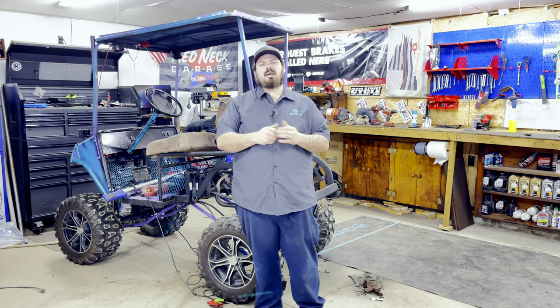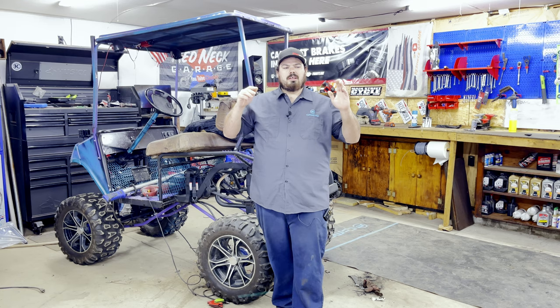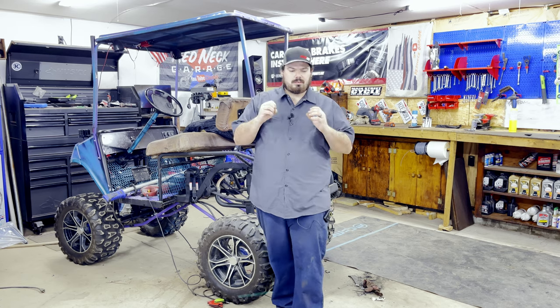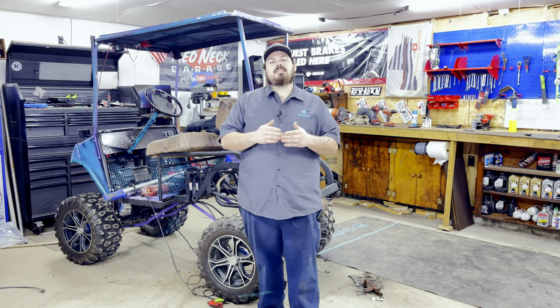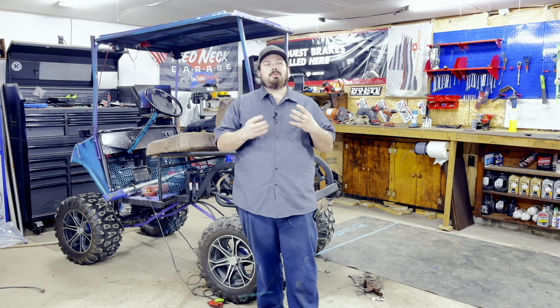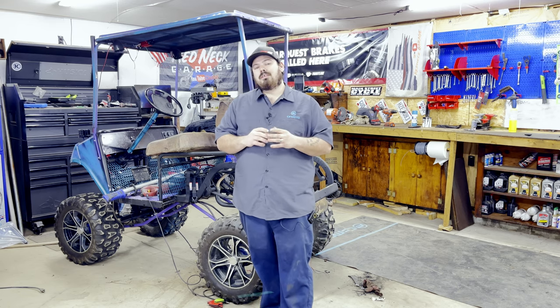So everybody's had a lot of questions about clutches and the jerkiness of the 400s, the 500s, the 600s, the 800s, the 1000s, whether that's a C-Force, Z-Force, or U-Force. The jerkiness, you've got to rev the throttle up. Well, I want to let you guys know that Main Street Cycle actually is selling clutch kits for all those that will help with that. Another thing, though, depending upon the situation you're riding in, whether it's mountain climbing, rock climbing, or mud bogging, that's going to depend upon what setting you really want to put your secondary at.